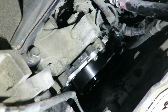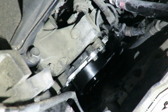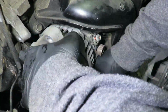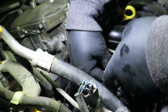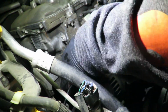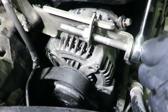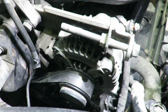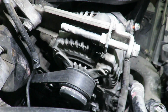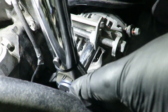Yeah, pretty much nothing. All right, water pump is installed. I'm gonna go ahead and clean it off, and we'll put the alternator back in. Okay, now that the alternator is in, now we gotta put the serpentine belt on. All right, the tensioner is set. Now we just torque down the two mount bolts. Okay, they say the top bolt is 14 pounds.